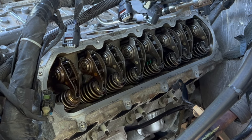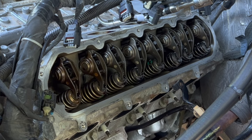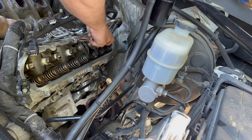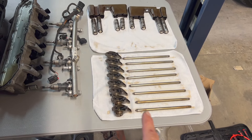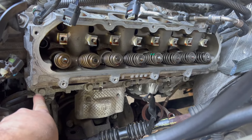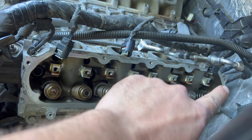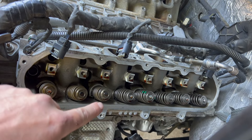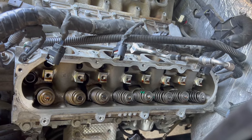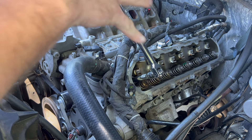Before I remove the rocker arms I rotated the engine to make sure the valve springs are all the way to the top with no tension on them — that way it's a lot easier and safer to remove the rocker arms. It's very important to make sure they stay together in sequence. Now that we've got the rockers off we are ready to remove the head. It's got 15 millimeter bolts, however there is also a hexagon bolt in there that is a 13 millimeter. I'm going to start from the outside in, doing 90 degrees at a time across all bolts, then 180 degrees, so it loosens evenly.